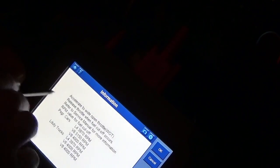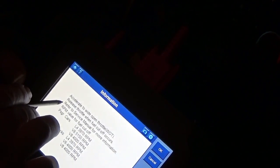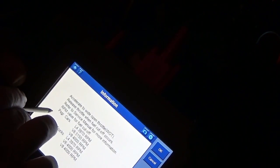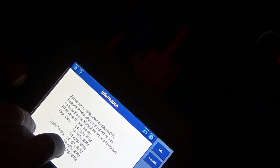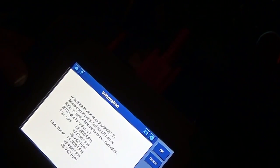I'll go through the steps. Accelerate to wide open throttle, release throttle when fuel cutoff occurs. This is the light duty truck with the V8, so 4,000 RPM — we don't want to exceed that. Engine should not accelerate beyond calibrated RPM value; release throttle immediately if that value is exceeded. Refer to service manual for help if needed.